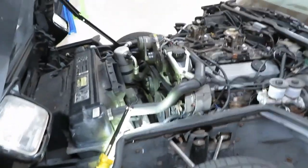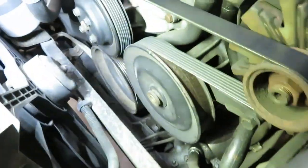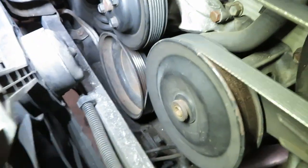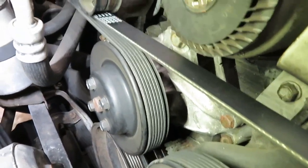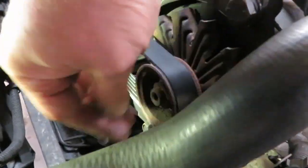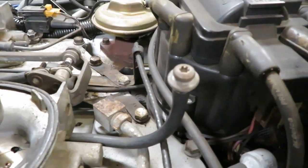We're back, got it all done. Belt's on, fit perfectly. Here goes the routing: there's only one way this belt will fit. You go down around the harmonic balancer pulley, then it comes back towards you around the water pump, shoots across to the AC, then back across to the alternator. When you put it all on, leave the alternator pulley for last — the belt will hang to the side, and as you lift it up the tensioner comes up and you'll be able to just get it on. The only vacuum line I have off is this one going to the air cleaner assembly.